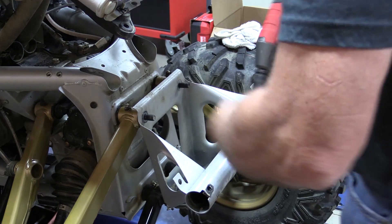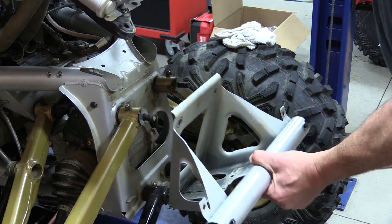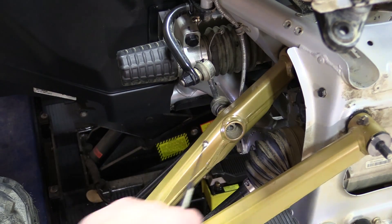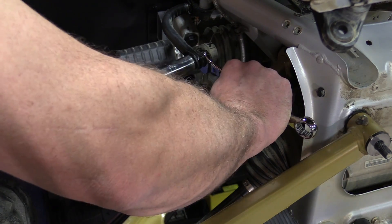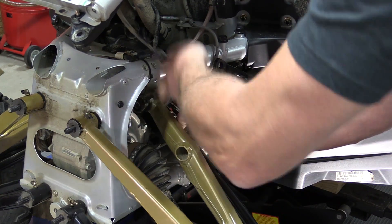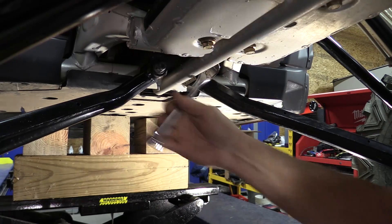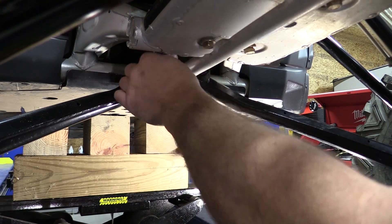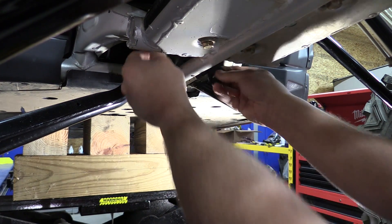When you're pulling off the front bumper, make sure everything is supported well because everything here being single shear, the bolts will move back and forth. It's a great time to remove both sway bar links — and if you're going to upgrade them, it's also a wonderful time to put in some adjustable ones. We have some from Assault Industries we're going to put in after this. Get the bar out of the way and we're going to start removing the nuts from the upper and lower A-arms towards the back of the machine. You can see the paper-thin braces on the side — they don't really do much, which is why we need to put this gusset kit in.